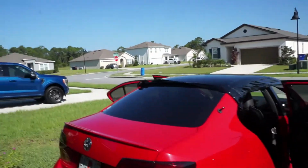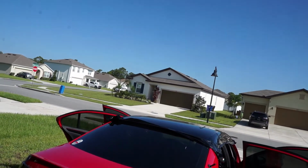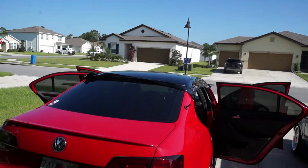I would highly suggest doing this in a garage. Or if you're going to use Vivid, it has a high tack, which this vinyl is very, very sticky. Use tack releaser. I think next time I go with a brand, I might go with something like Avery, which is not so sticky, because laying it down in the heat is pretty much activating the adhesive, which, oh man.